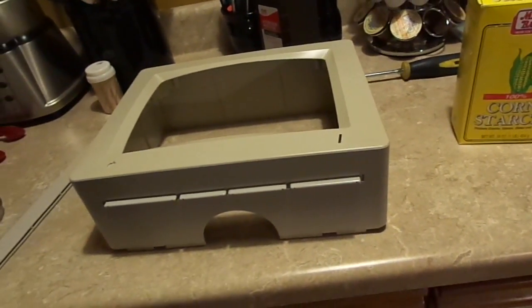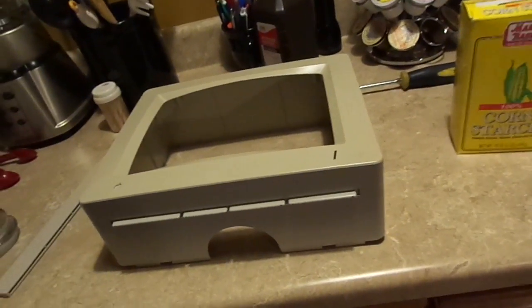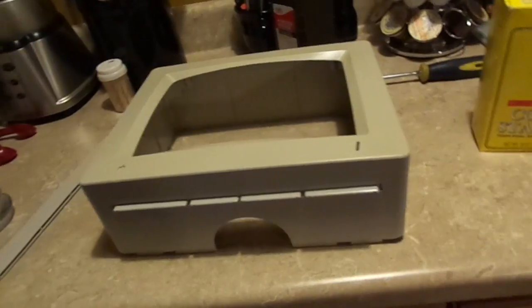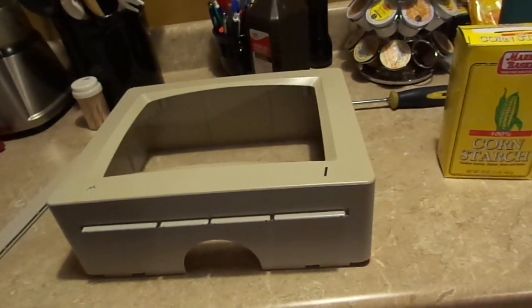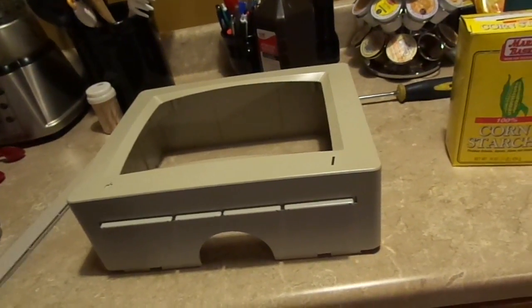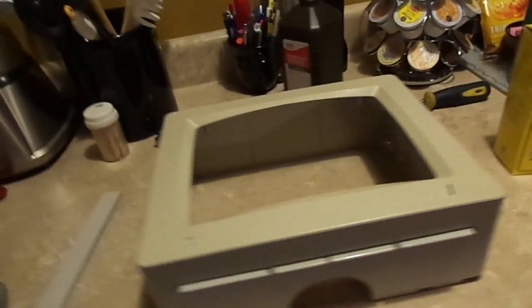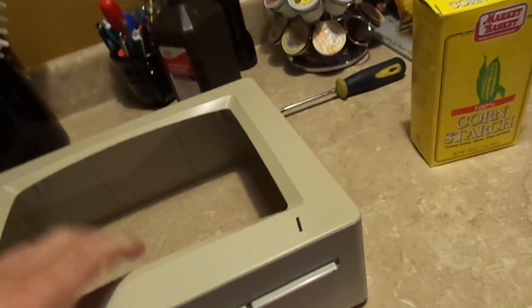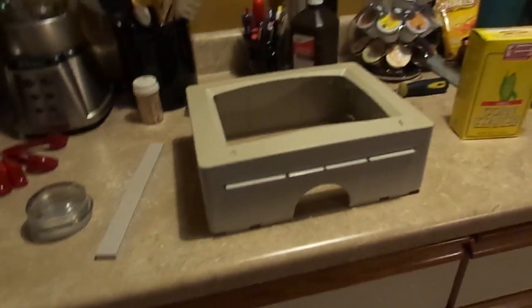For the rest of this week it's supposed to be overcast, and the thing is you have to babysit the retrobriting process — you don't just stick it out there and go to work. You've got to keep reapplying the gel and rotating whatever you're working with, since not all four sides get the same amount of sunlight. If you do the plastic wrap method, be careful because you can get zebra striping and unevenness in your retrobrited surface, which can be pretty ugly and require redoing.